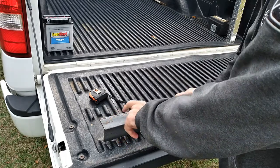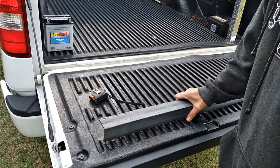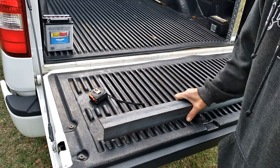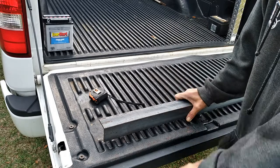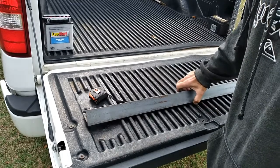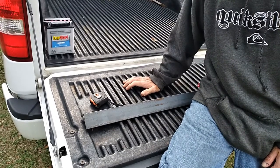Drill the holes, and basically the hole here is going to be a piece of all-thread that's going to go all the way down through the sleeve. I'll cut a plate at the bottom to hold where that goes through, and then you just twist it off with nuts and pull it up. It's not a whole lot of pressure — it's not like you're pulling a dry sleeve. With wet sleeves, the only thing that really holds them is that O-ring, so it should pop right out.